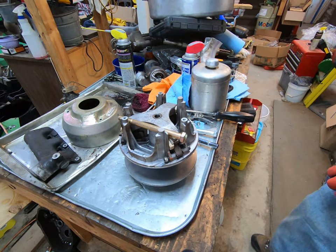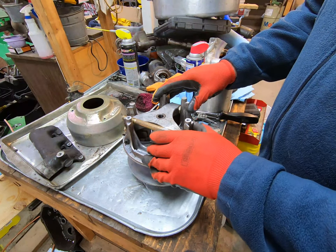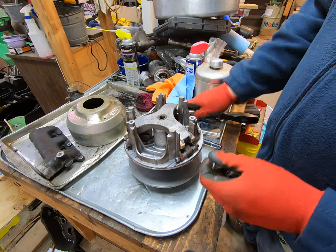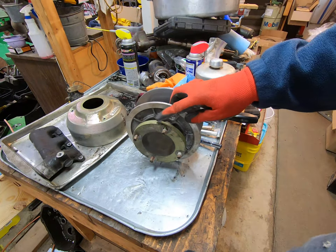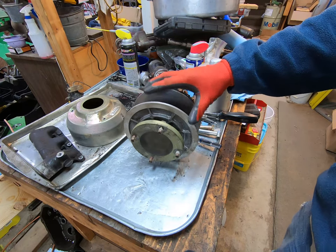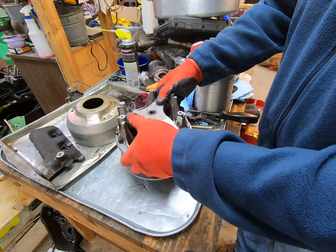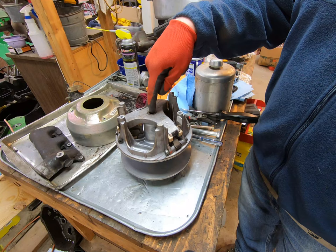Here's something pretty interesting. What we have here is the clutch that was on a John Deere Gator — the Gator is now gone, so I just have this clutch left because I want to sell it. This plate right here actually mounts to the flywheel of the engine, and then this is the clutch itself. This plate here is actually pressed onto the clutch of the Gator. To get it off, Deere has a very specific puller that goes down in this hole right here.